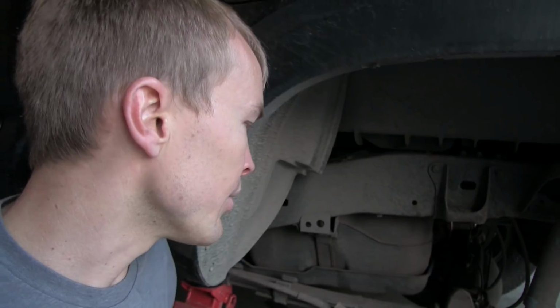So when you're doing this rear portion of the vehicle, it's sticking back pretty far from any nearest front point. So we had a jack stand, or I think actually we ended up with a floor jack under the rear hitch, just as a secondary precaution to make sure that we're safe as we're doing the installation. You're wrenching on a lot of items when you're doing this work, and you'd hate to knock the vehicle off the jack stand.